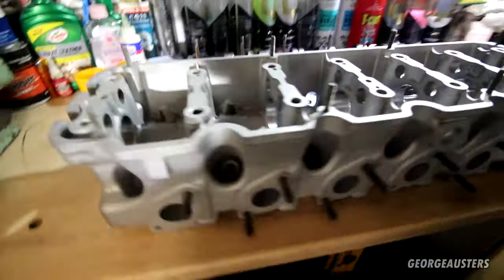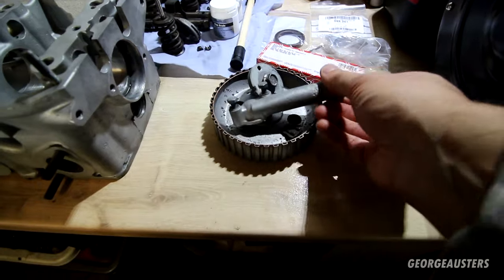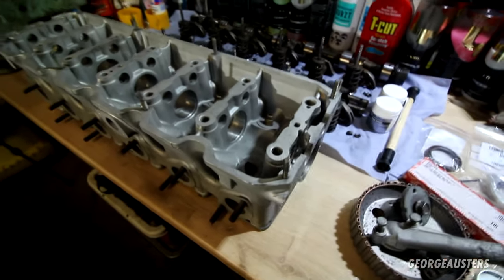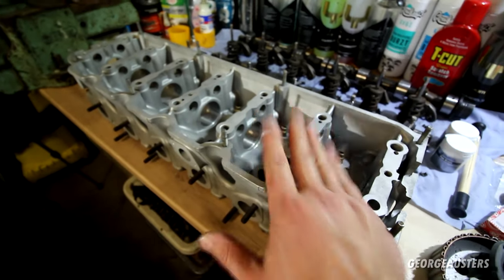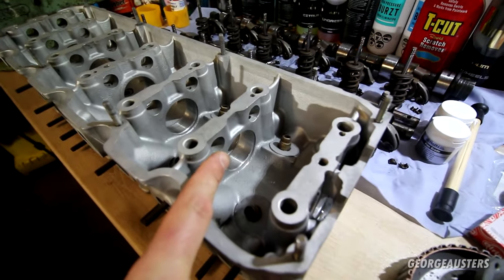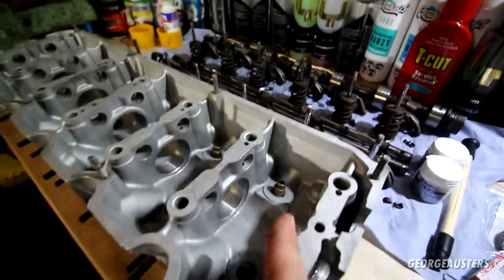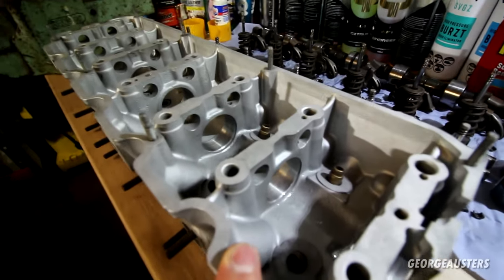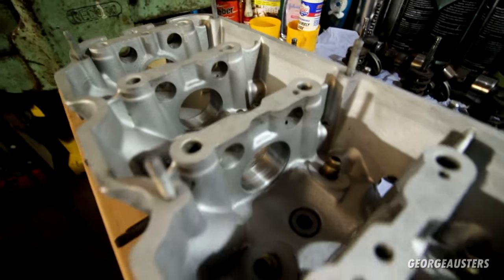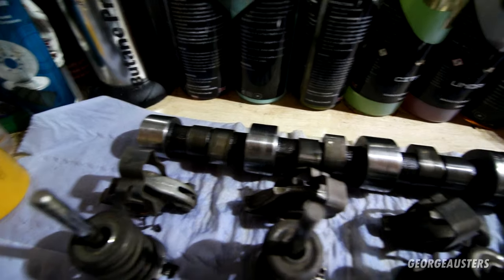It's a 44-year-old cylinder head and it looks so, so good. Of course we cleaned up the camshaft gear and this pipe and a couple of little bits and pieces as well. Has it got rid of the damage on this cylinder head though? No, of course it hasn't. He has however given the camshaft bearings a bit of a polish up - they look a lot better. I've tried the camshaft in here and it moves a lot freer, but we still have the scoring in here, and it's pretty much the same story for the camshaft as well.